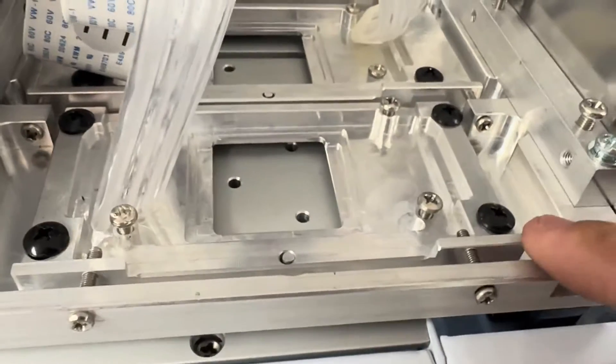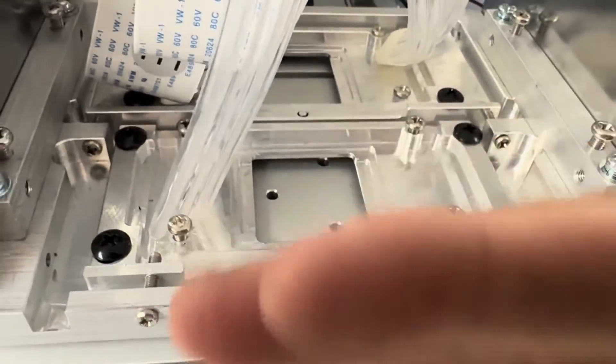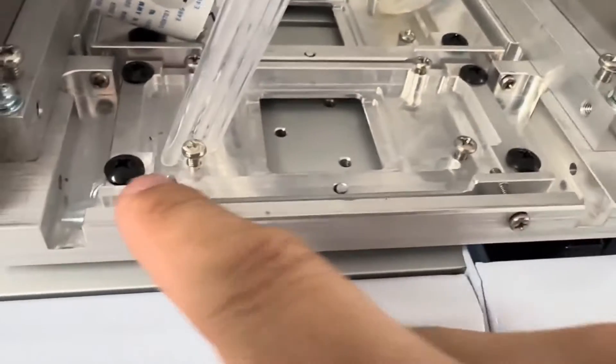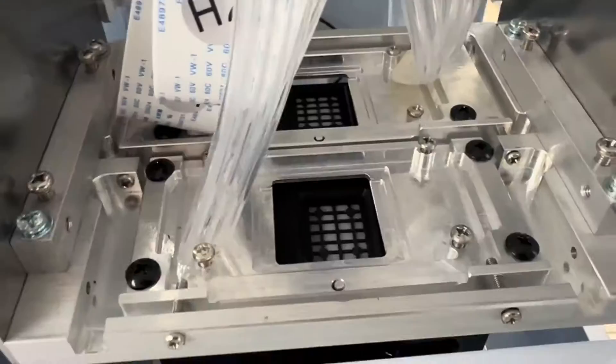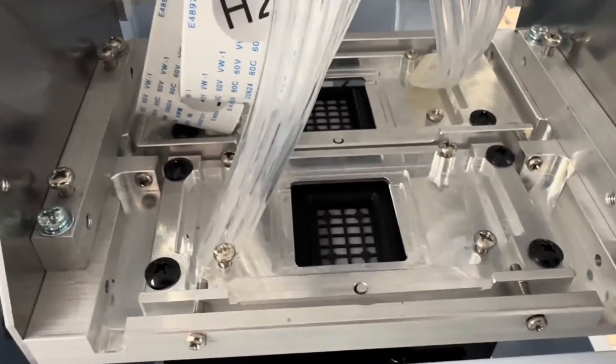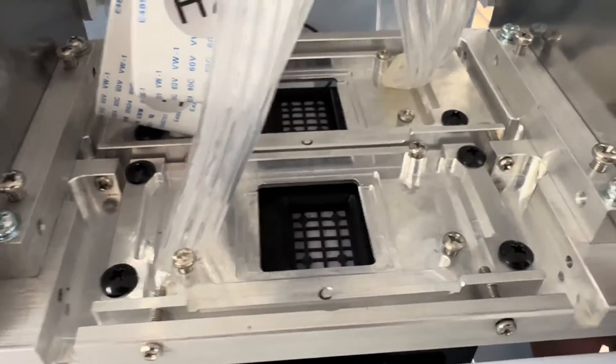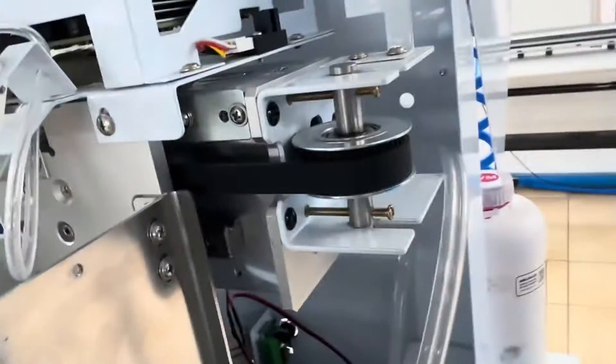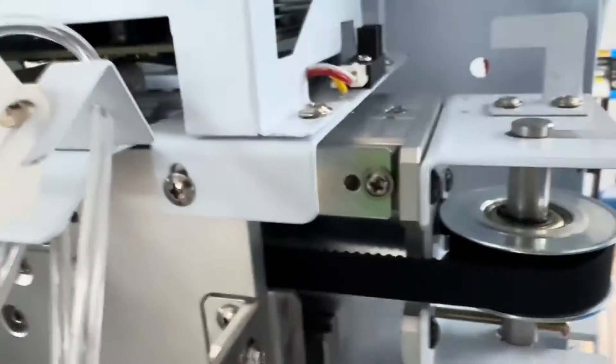You can push in this tiny plate. This also adjusts the tilt — the print head is supposed to be horizontally aligned, but if it's a little bit skewed, you can skew it back using this. Then we have another kind of misalignment: left and right. Left and right is adjusted in the software — basically a setting for the timing.